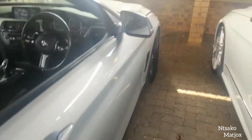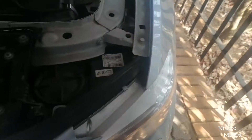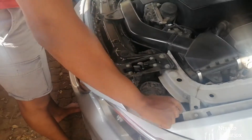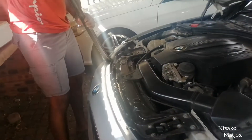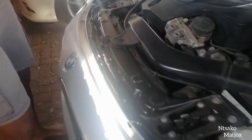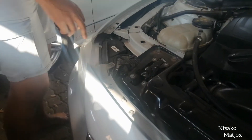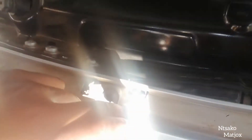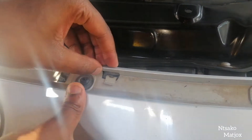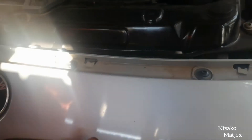So we've pulled in the Beamer. As far as I know, this weather strip here must come off, so I'm going to pull it off from the side and then speed you up once I've pulled it off. So now I must take out one, two, three, four, five, six, seven, and eight. If you look in here, the bumper must come behind under this clip as well as this one on the side — there are four of them — and then it will give you room to push the clips out from the bottom.